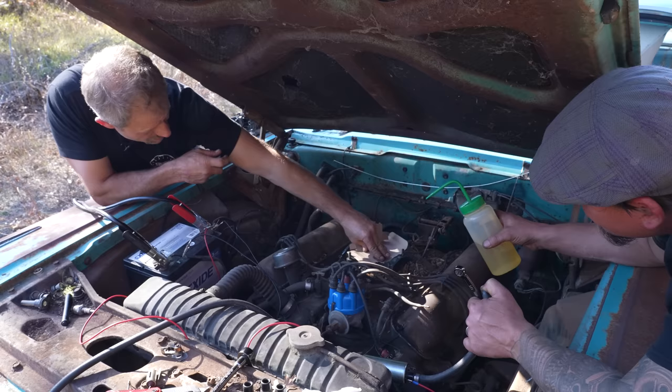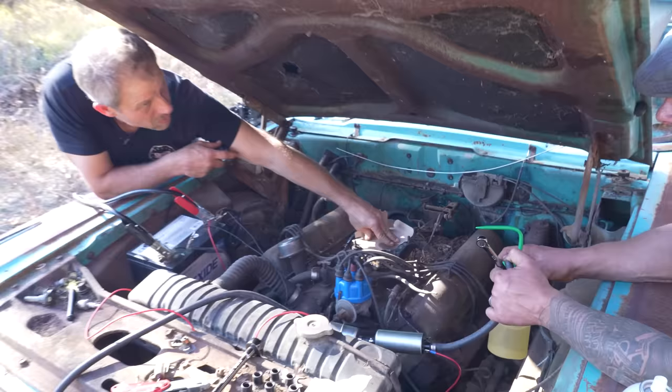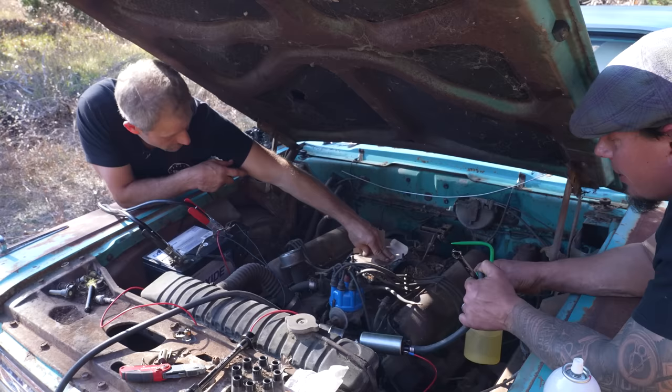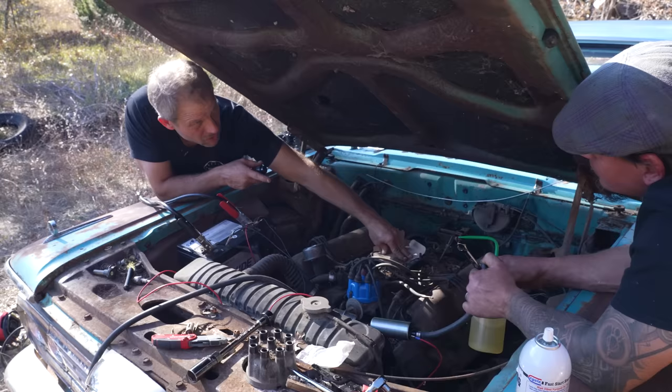It's got very little pulse. Yeah, we must be in the spot where we have like no compression. Well, that could be doing it, because it could be not mixing the air and fuel correctly, and just not drawing anything in. I say we do this. I say we call it a day, take the batteries back, get everything charged up, bring a compression tester back, and check it.